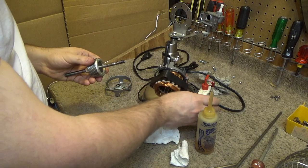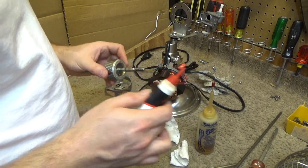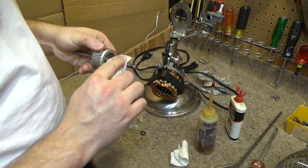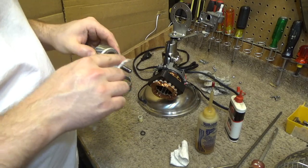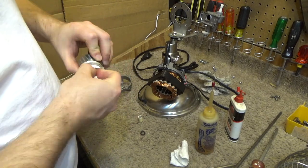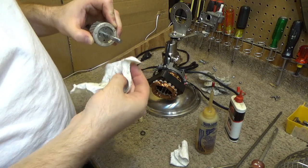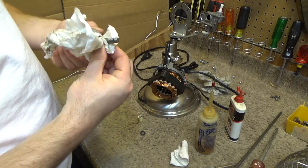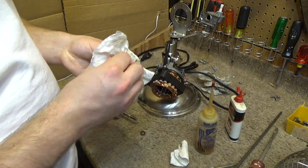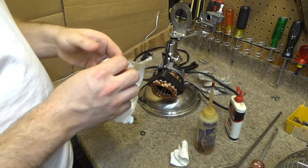This may be partially to blame on the manufacturer for using the wrong kind of oil or a very cheap oil. That could be the cause of this. It's hard to say. Could just be lack of lubrication and the extra heat from the additional friction just caused everything to lock up and get all grimy like it is. My guess would be probably cheap oil.